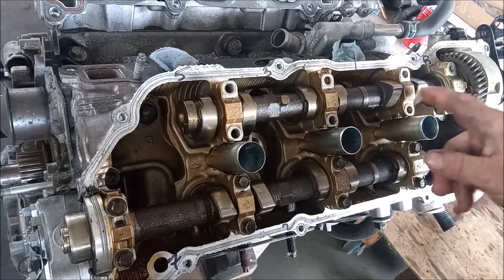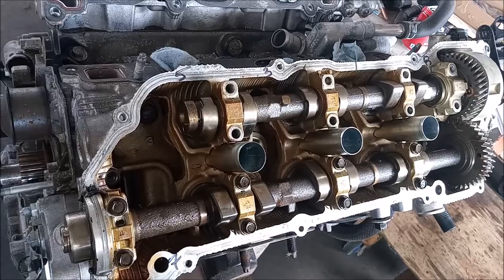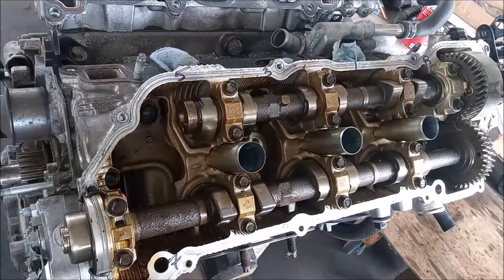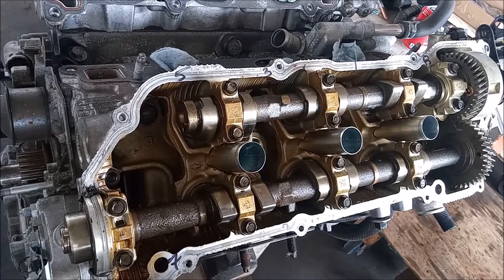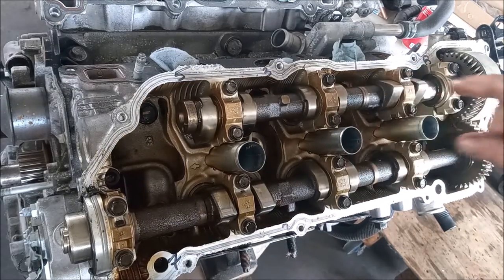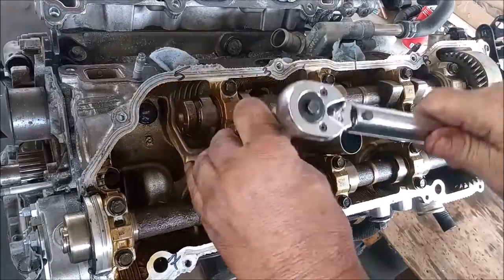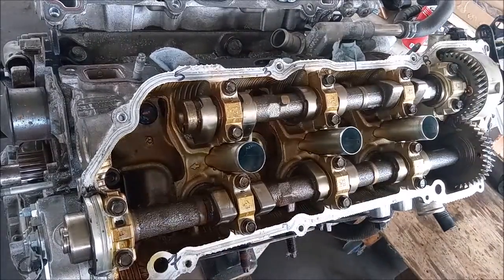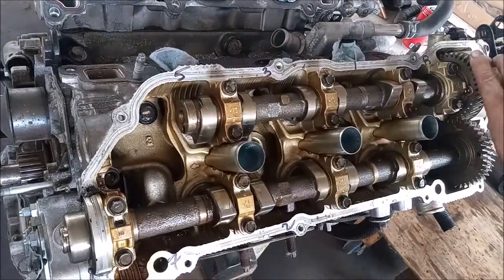These cams go on I-1, I-2, I-3, I-4, I-5. All the arrows point this way. We're going to put the bolts in, snug them down, and then torque them. The bolts are all finger tight and we're going to torque them with the torque wrench — same torque, 12 foot-pounds. The order for these bolts is one, two, three, four, five, six, seven, eight, nine, ten. They've all clicked; we're going to make one more pass just to verify.